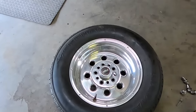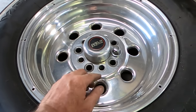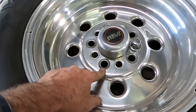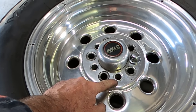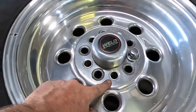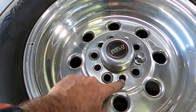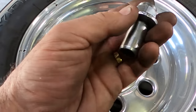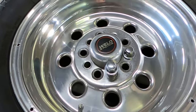So wheels going back on, and we've run into a little drama. These weld wheels have specific nuts and washers, and the drama being, whoever's owned them previously on the Holden pattern used a big wide weld style washer, but when they were used in the Ford pattern, which this is now, Ford stud pattern and Ford studs for the bigger stud, this guy here, they've been too smaller washer and too smaller nut. And so that's actually crushed that edge in. If you see, it's a very small washer, whereas these guys specifically for these weld wheels. So when that's crushed in, won't fit.